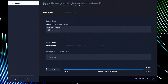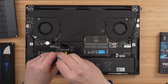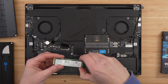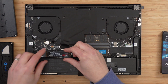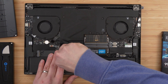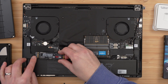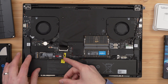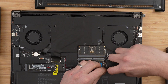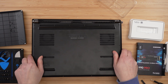With the machine powered off and the base plate removed, I'm taking both SSDs out of the system. I'm now putting the freshly cloned Samsung 990 Pro into the primary slot in place of the original 1TB SSD. The heatsink goes back on, and then I'm installing the secondary drive — in this case a Samsung 980 Pro. It's not as fast as the 990, but as it's only going to be holding games, I'd rather save a few pounds. Once the second drive is screwed into place, we connect the battery connector back in, screw the base plate back on, and we're back into Windows.